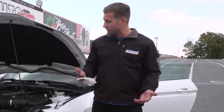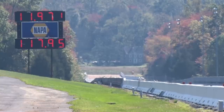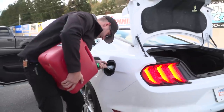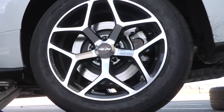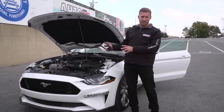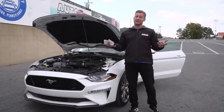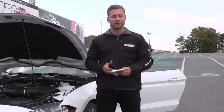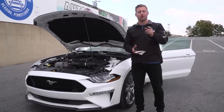Very impressive out of an otherwise stock car with just a tune and different fuel. Bone stock, the car ran high 11.90s — very impressive in its own right. With the 93 octane tune, the car went a little bit faster. But ethanol plus tune, still on stock all-season tires, got us to 11.63 at 121. We tried the radials but it turned out we didn't need them — this thing was never really traction-limited, so they only ended up hurting us. Hope you enjoyed the video — stay tuned for more with this car. I'm Justin, thanks for watching. For all things Mustang, keep it right here at americanmuscle.com.